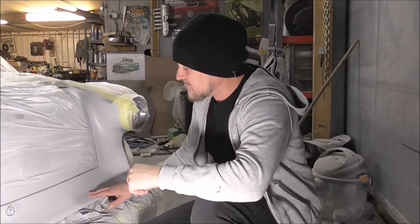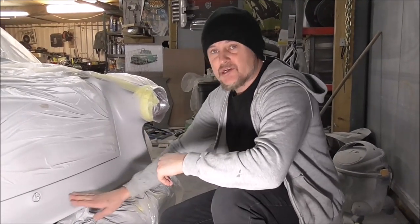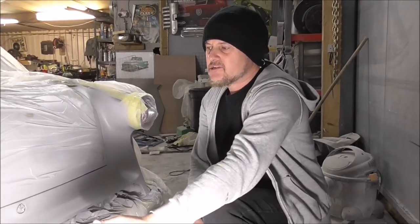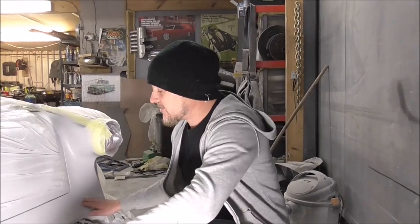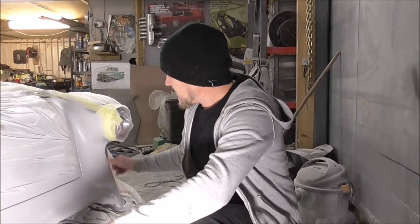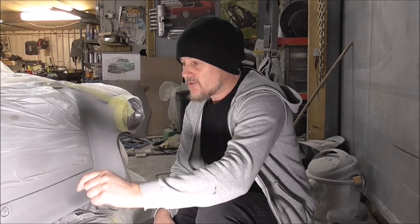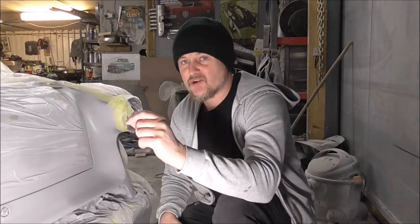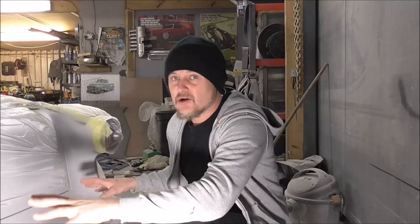I've gone over this with four coats of high build primer. What I'll do today is flat all this back. If it was really rough you could go 120, but I'd always recommend you go 320 at first and finish up with a 600 - that's going to be super smooth. With filler, just get it straight, just get the shape. Actually getting it super smooth is not necessary because you've always got the high build primer - treat that like another coat of filler that just goes over the whole thing.